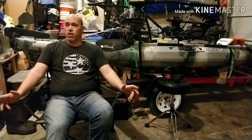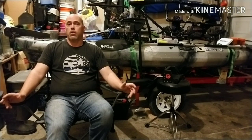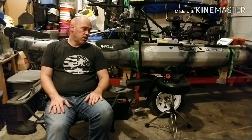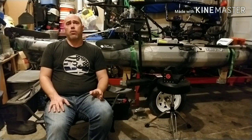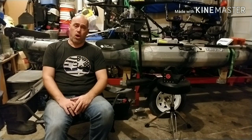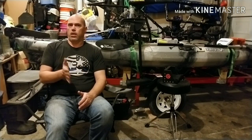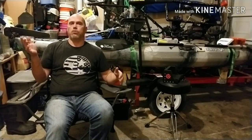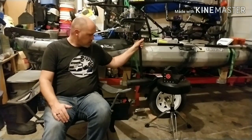While I've absolutely loved having this motor mount, the places I can now reach have way opened everything up. The only con I've found is having the motor mount right on the side — I don't have a lot of steering control and I'm having to use a lot of rudder. My Sea Ghost 130 has that rudder, but I don't have a lot of control, especially going left, because the motor on the left side automatically pushes the boat right, so I have to keep it offset.